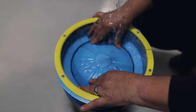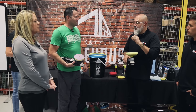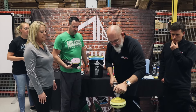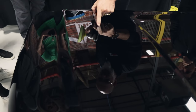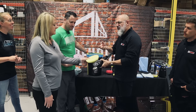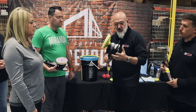Another very important tool is the pad washer — it has some rinseless wash in it. It's going to clean the pad and prime it. A lot of detailers prime the pad by putting a lot of polish on it, which just creates dust. You never want to dry polish — if you put a dry foam pad on and run it, you actually scratch the surface. If we dampen the pad using a pad washer, it goes from firm and scratchy to much softer. Now we've softened and primed the pad and we won't scratch anything.